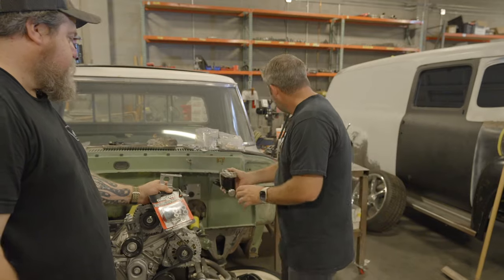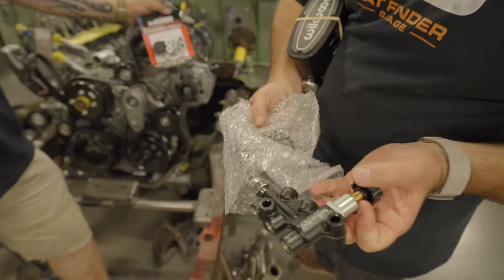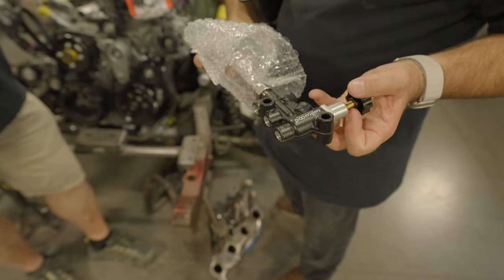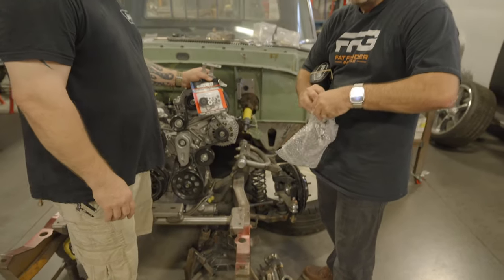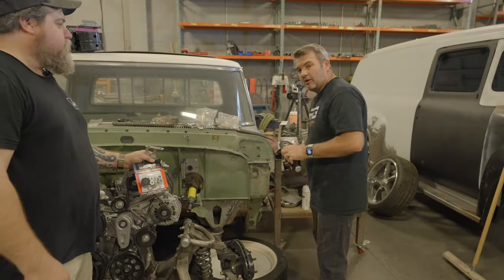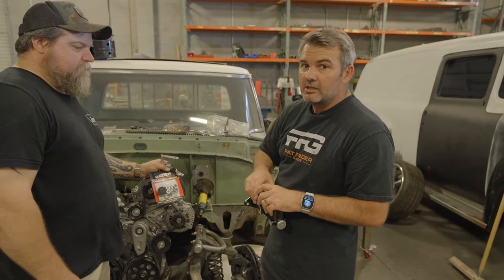Then get this on here. You may have a proportioning valve that you purchased — it's got brackets that come with it. That's going to do your parking brakes and regulate your brakes to the rear. After all your braking system is working, you just want to set that up and dial it down so you're not locking up your rear brakes.